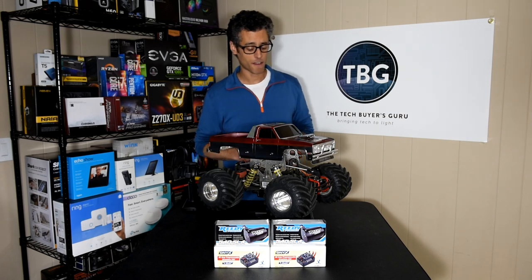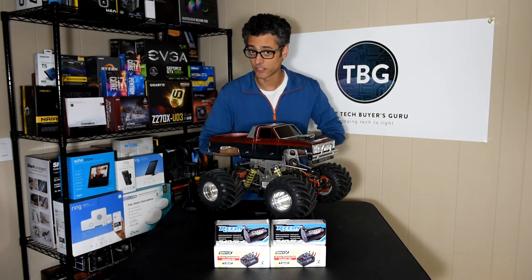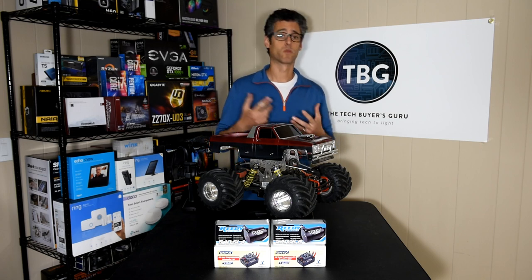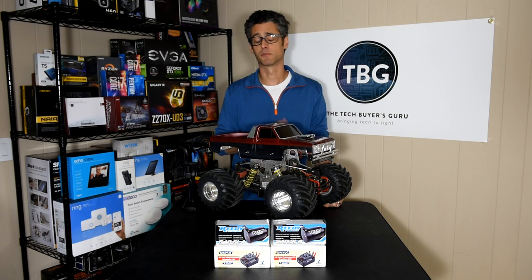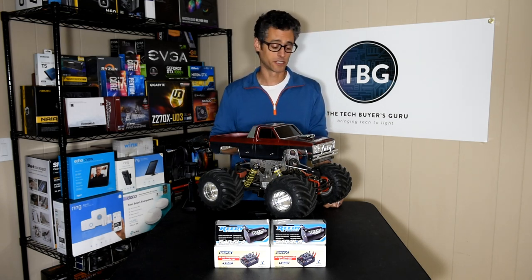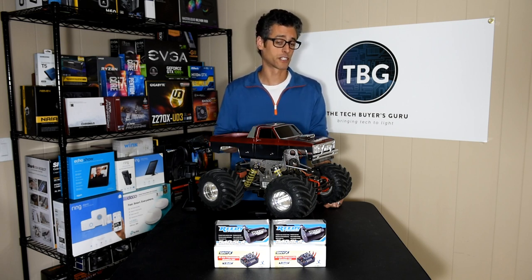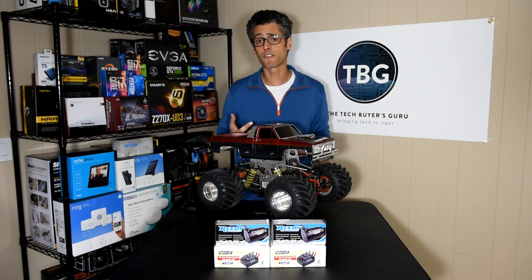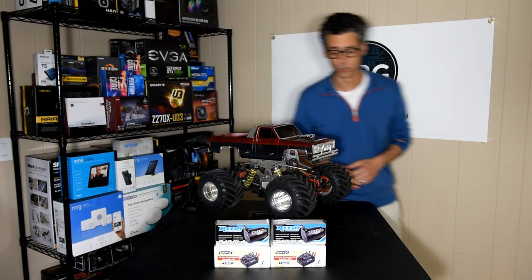Because it's got dual gearboxes and dual motors, that's a little bit harder than converting your typical RC truck to brushless. So let's get into it. First of all, you're going to need to get two motors and two electronic speed controls. Unlike with brushed motors, you can't run two brushless motors off of a single controller. When you go brushless, you've got to go to dual motors and dual speed controls.